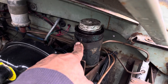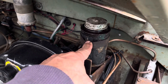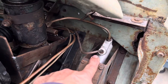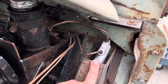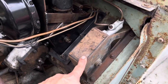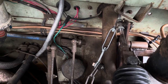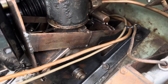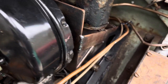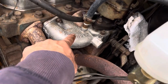I eliminated one of the inner cylinders that used to separate the master brake and master cylinder, and I've dedicated it solely to the clutch. So this is the reservoir for the clutch itself. I've done a series of bracket configurations — I'll show that in more detail later in the video. I still have some little issues with flexing that I need to address with some bracketry and gusseting, but overall it's working.